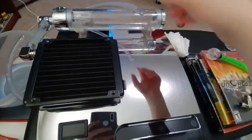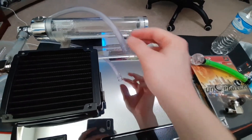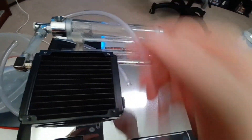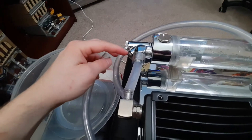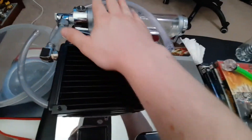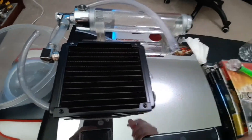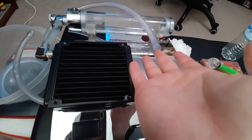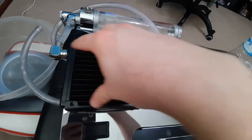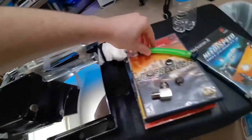What we did was take off this elbow piece and put a stopper on there so I didn't have to worry about fluid going back down this tube, and same with this one on this side — we replaced it with a plug. That way this radiator and reservoir are completely disconnected from the system and sealed up on both ends, so nothing's going in or out. There's probably still a little bit of fluid left in the radiator, but I did tilt it back and up so that everything would drain down this tube and go back out through the little drain I made.